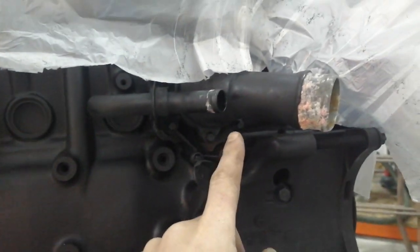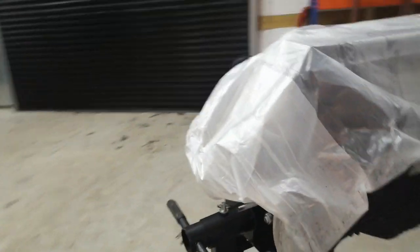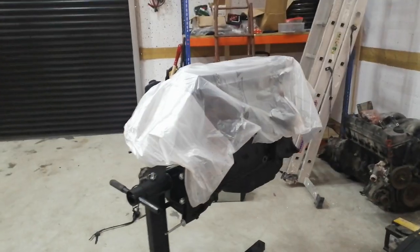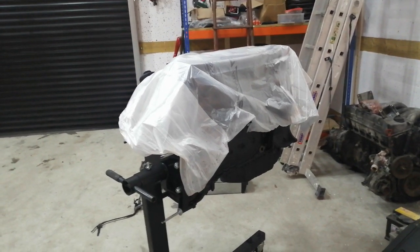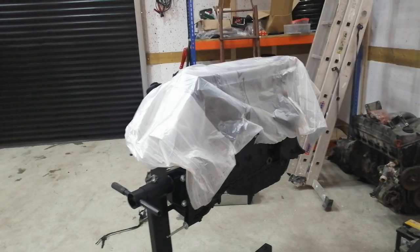So you get your cooling from here as it's fed from the water pump, and then it's also pumped back here as well, and so your cylinders are getting more evenly cooled. I think Dieselmechan said it was something like a 20% or 15% addition to the cooling of the cylinders, on the rear cylinders. So, I mean, it's a worthwhile thing to do.